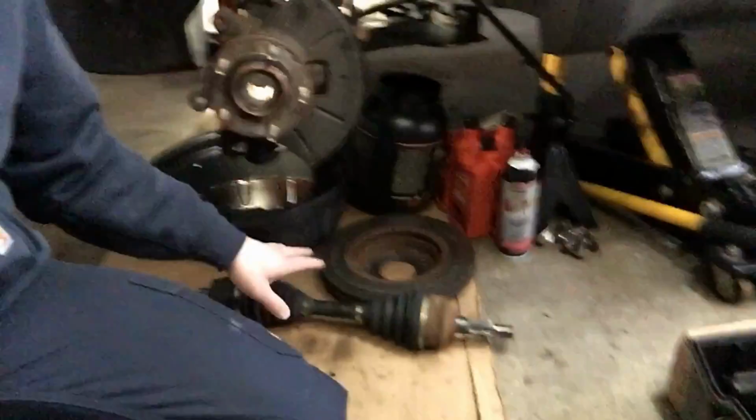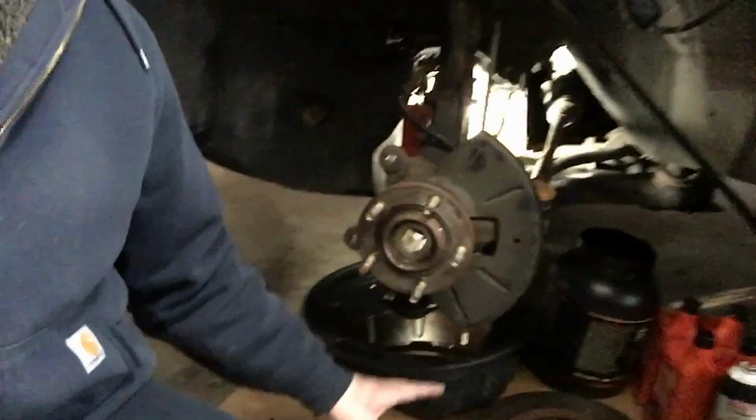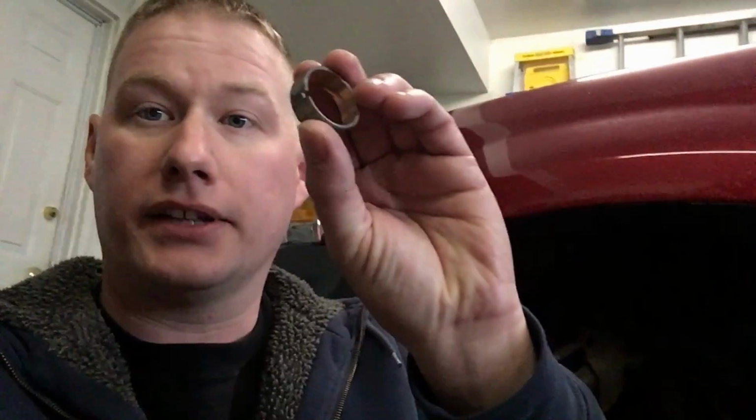You can see the axle shaft in the ground here, stuff like that. It's all apart. The bushing on the transmission is worn out, and it looks a little something like this. Now, it's not available from Ford. That's the big problem here. So I was able to find the correct bushing online from a trans shop, and we're gonna take the old one out, and we're gonna press this one into the driven sprocket on there today.